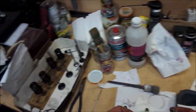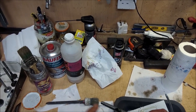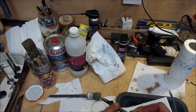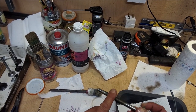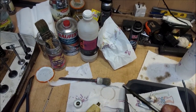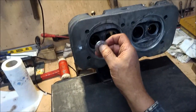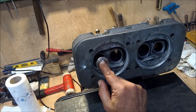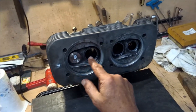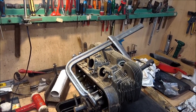Now we take the new valve - mark which end of the head is which. A little bit of molybdenum sulfide grease - we're going to use MoS2 just to help the thing as it starts its working life. Then we'll turn the head around and start fitting the valves. We're going to now refit the valves and springs - the reverse of the removal procedure.